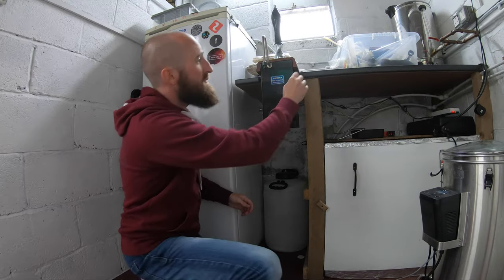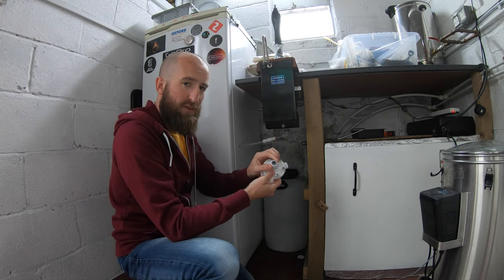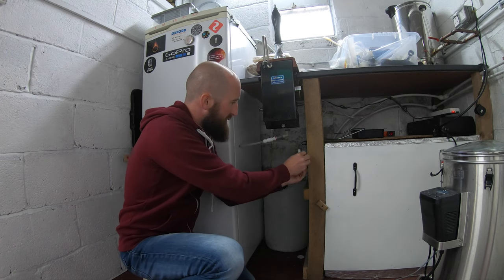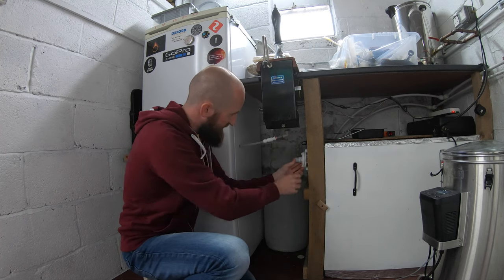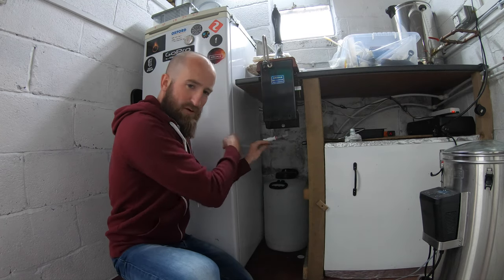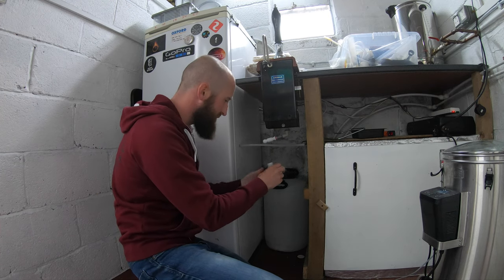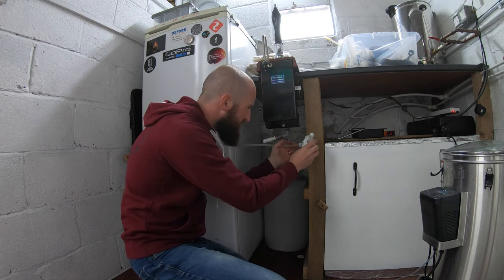Let's install this check valve - demand valve. I'll put the link in the description below. The inlet is 3/8 inch and there's a half-inch barbed fitting coming out. I need to put something in place for this to mount and get the pipe going round to the back. I'm pulling this out of the fridge - I've got quite a bit of slack in there already, don't want to flex this about. I think on this post should be pretty ideal.